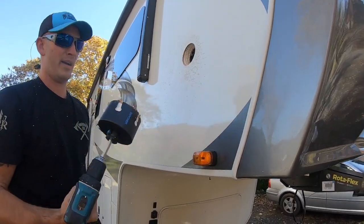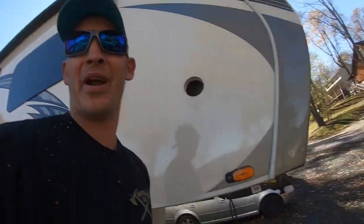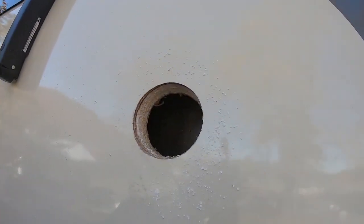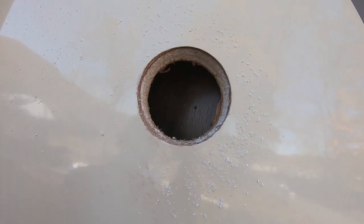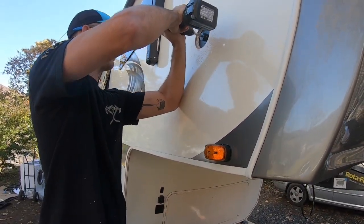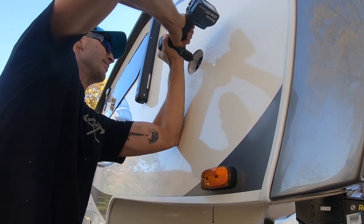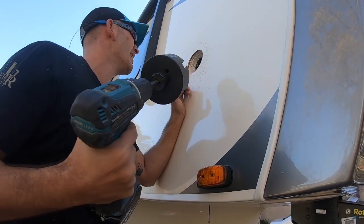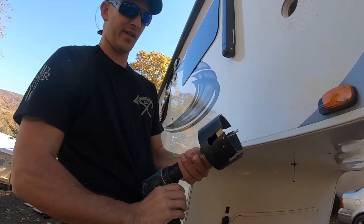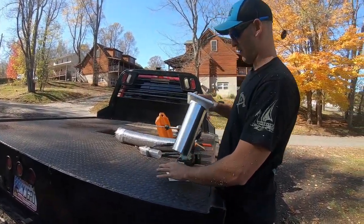This is by far the scariest part of the job — drilling a hole through your brand new rig. We now have a four and a quarter inch hole through the outer wall and now need to drill through the inner wall. You have two choices: you can go back to the inside for a cleaner drill from inside to outside, or if you let the drill do the work, you can just slowly let the drill bit pull you through the interior of the wall. If it does happen to blow out some splinters on the inside, it doesn't really matter — it's behind your washer, and we're going to have a plastic flange that covers the gap and makes a stiffer connection.